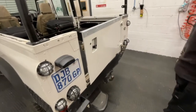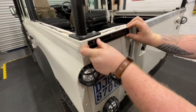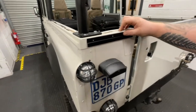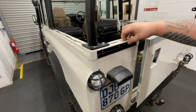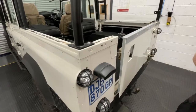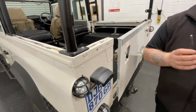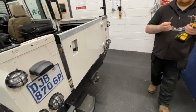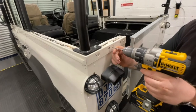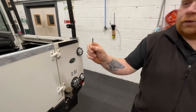Start at the back with the short section. Make sure you get it in the correct location — it lines up on top of the capping about three or four millimetres from the top of the bodywork, set fairly central with an equal gap at either end. Mark the holes with a pen, then centre punch them. Using a 4.2mm drill bit and wearing safety glasses, drill through the capping at the punched hole markings. In the fitting kit for the belt rails you'll find black rivets, which are used to hold the Z channels to the back of the vehicle, fitted using a pop rivet gun.